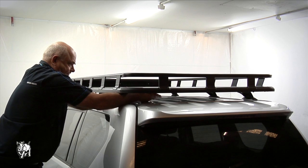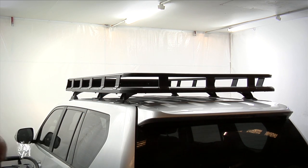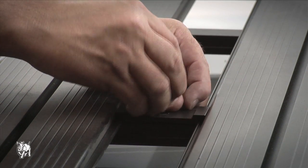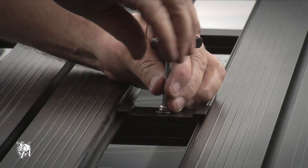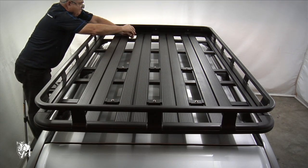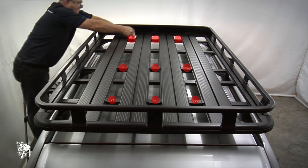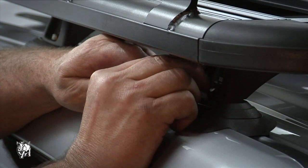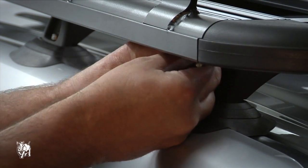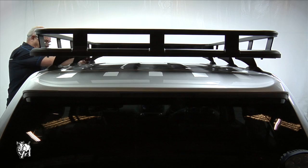Tighten security screws to secure the legs to the vehicle. Recommended tightening torque is 3–4 Nm. Fit locking tabs to secure the planks onto the crossbar using the security screw, spring washer, flat washer, and fit the locking tabs onto the cage nuts within the crossbar. All locking tabs are required to hold the tray firmly into position. Place the M6 screw washer assembly through the heavy duty leg kit and fasten to the mounting pad using the supplied 5 mm Allen key. The recommended tightening torque is 3–4 Nm.